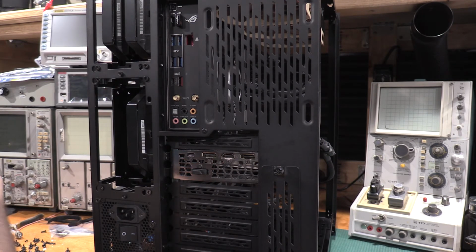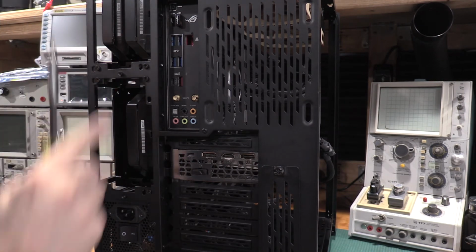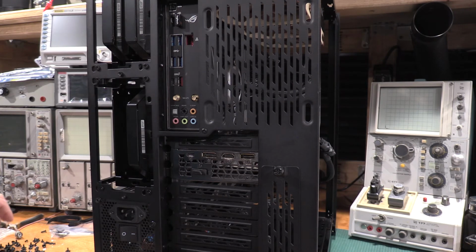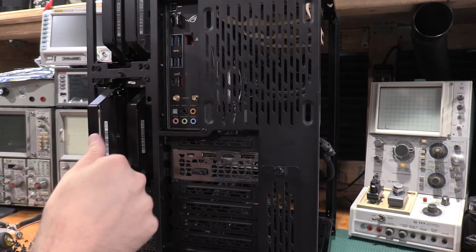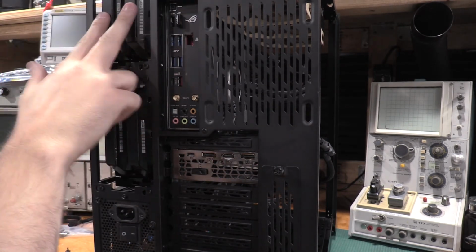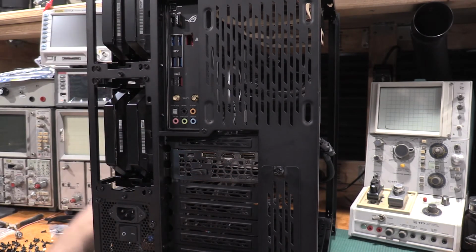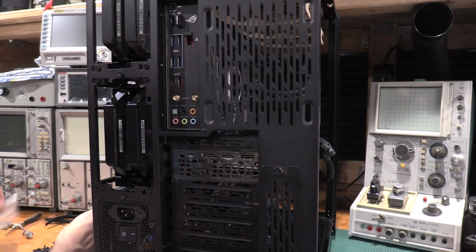Also, because it's bulk storage, I didn't want to take the size hit of RAID 10. This is going to be a RAID 10 array of four 4-terabyte drives, but I only end up with 8 terabytes redundant. If I went with RAID 5, I would take a slight speed hit, but I would end up with 12 terabytes. RAID 10 is the highest performance until you get into server stuff, but you do take a size penalty, because instead of just losing the size of one drive, you're losing the size of two of the drives. It'll be a stripe, and then the two stripes will be mirrored for the redundancy. So it'll still be quick, but it won't be as big as it could be using a different RAID set.